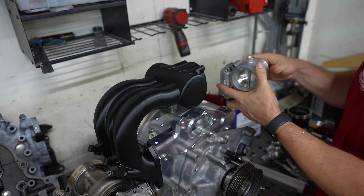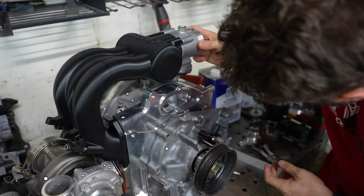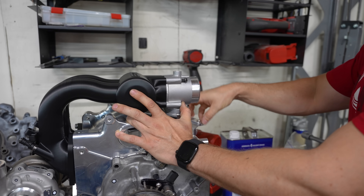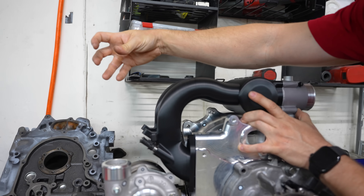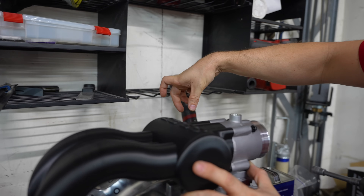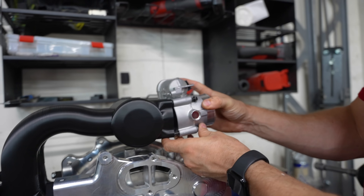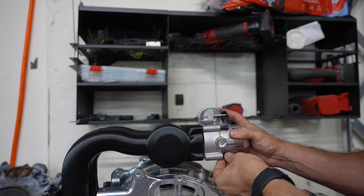One of the downsides is we can't hook it as easily because this hits. We'll use the Billet Pro front plate once we clean this up. The fuel rail will then be very far away from the turbine and very thick-walled. Now I want to get the throttle body on there. He was playing with bringing the whole thing lower, so I'm worried about it hitting the engine. It's two-and-a-half inch — what's the tightest radius you can do and how does that affect the oil filter? It'll go from this to two-and-a-half, then 90 up, 90 over, go to the intercooler brick, back down, and then 180 into here. Worst case, we turn it back like this — it's ugly, but not as ugly as the alternative.